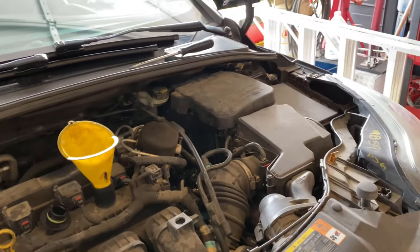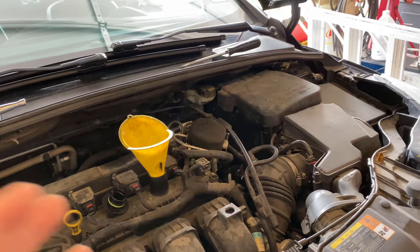After doing a lot of research, searching different forums and calling Ford dealerships, there is apparently a TSB from 11-7-2013 which was made for the 2012 Ford Focus. This is a 2013, so that TSB should not apply to this vehicle, but I figured I'd tried so many things — I spent countless hours checking the wiring harness, checking continuity — and I couldn't figure it out, so I figured let's give that a shot.